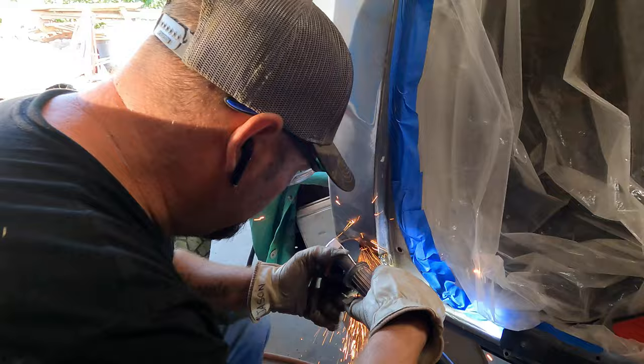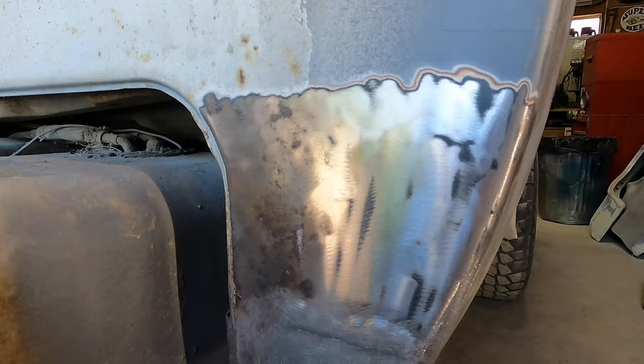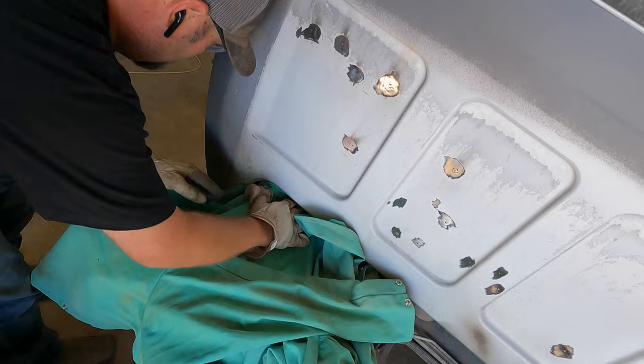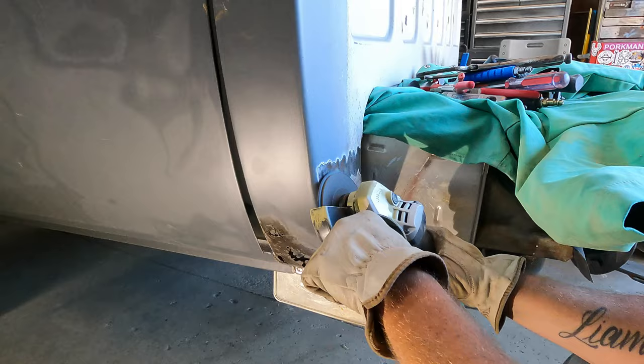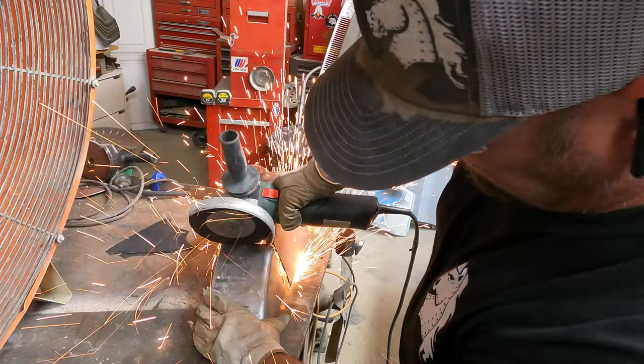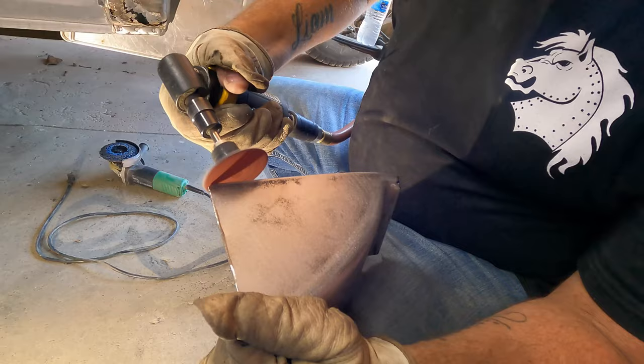Using a tried-and-true technique from our amigo Arco, Jason first grinds down the weld using the edge of the cutting disc before switching to the sanding disc to speed things up. Now that the patch is done and smoothed up, let's go to the other side. Using your wife's favorite cookie sheet and Jason's welding jacket, we cover the gas tank to avoid explosion. Preparing the driver's side cab corner for removal and replacement — Jason is cutting the cab corner piece down to exactly the size needed to make the patch, then shaping it and trimming out the old cab corner.